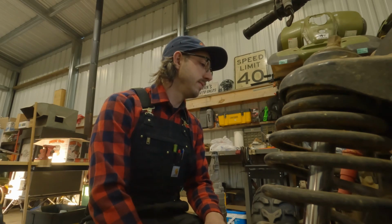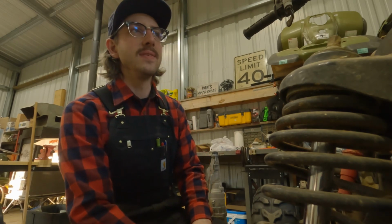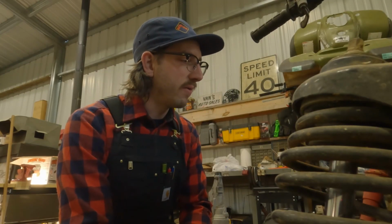Pulled the head off and saw witness marks in the piston from where the valves hit the piston. And I think they all four hit. As you can see, there's reliefs for each one, but there's definitely marks where they hit. I'm guessing the top end is okay-ish. The guy I bought it from told me the top end was rebuilt at some point.